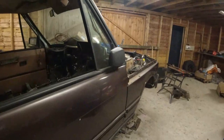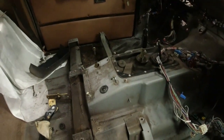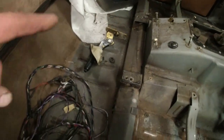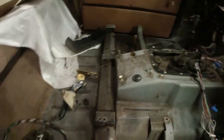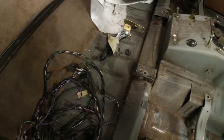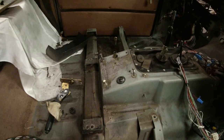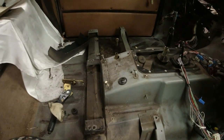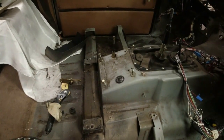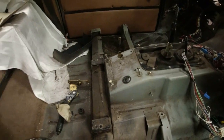It's been a semi-productive afternoon — six o'clock now. Handbrake, yes, absolutely spot on. Big C-clip about there holds the cable onto the handbrake body, with a nice big fat washer underneath it. However, the left-hand drive handbrake cable part number is different from the right-hand drive part number, indicating there is a different handbrake cable. So I'm going to get one of those; they're really only a few quid. It's not the end of the world.